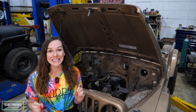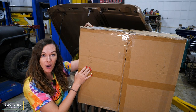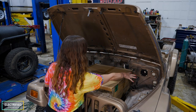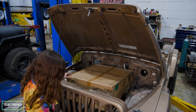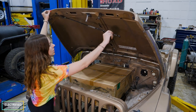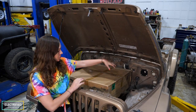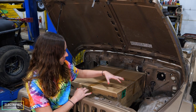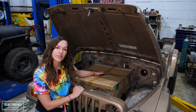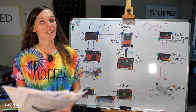The last thing I want to show you in this video is CAD work in real life — CAD: cardboard aided design. This is the size of our front battery box. I built this cardboard box so I can see if it fits. It will fit quite well. We'll need areas here for the 12-volt battery, for the electric pumps, and underneath we'll have the onboard charger and all that. This is where the battery will go — and the hood can still close! What we're doing now is building this battery box for real. Darren is helping us fabricate the underneath construction to mount the battery box here, and the same goes for the rear battery boxes. In the last video you probably saw that I worked on the VCU — the vehicle control unit — and how all these parts will communicate with each other in the future.